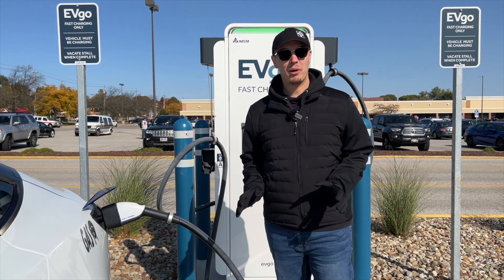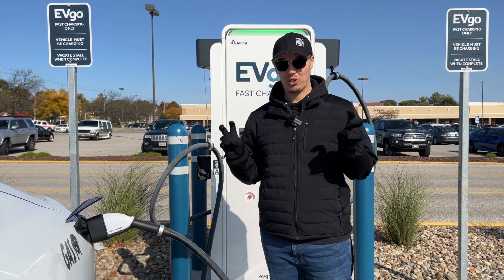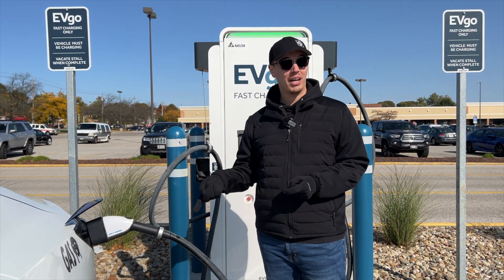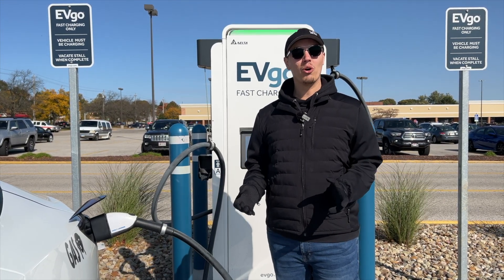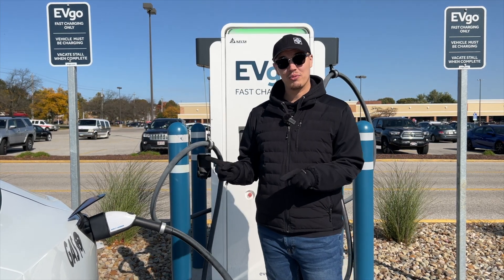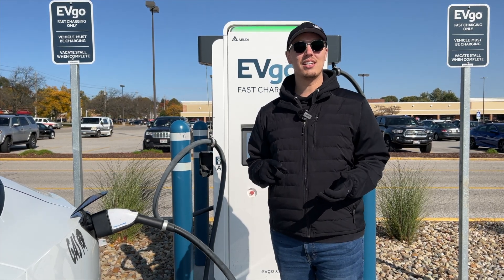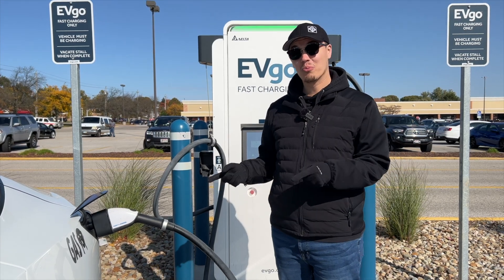To get a little nerdy about Auto Charge: it's not exactly using the engineering for Plug & Charge like Electrify America uses for other vehicles. It's actually connecting directly to the MAC address of the vehicle, which is unique. It's really cool that EVgo is figuring out workarounds like this. Auto Charge now works for vehicles like the Tesla, as well as the Kia EV6, Hyundai IONIQ 5, Genesis GV60, Polestar 2, Volvo, and many other vehicles.